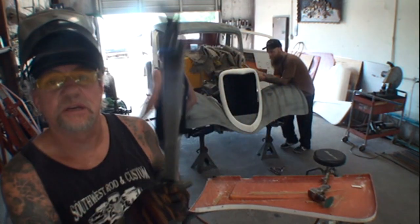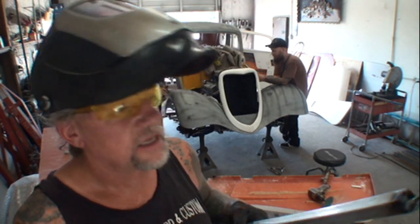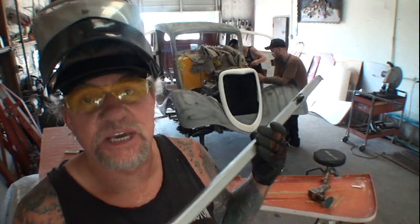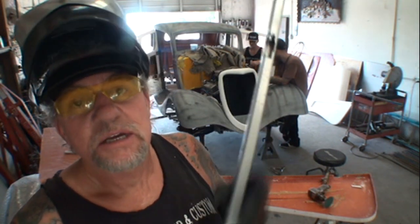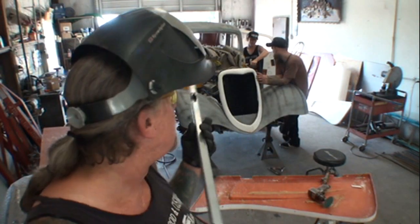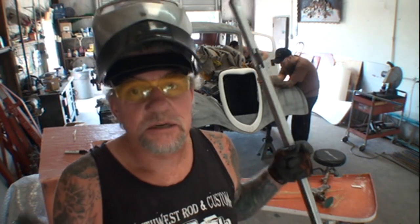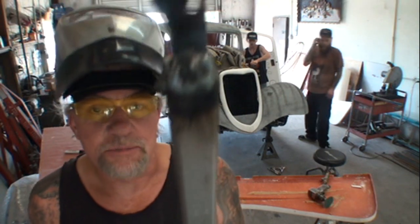I'm going to show you something here. This is a real situation, kind of a little DIY situation we got. When the owner bought this car, all this metal was bare metal. This metal has to be modified. It has to be fabricated and made to work on the car itself. Do not, and I'm going to repeat again, get anything powder coated on these cars until everything is completely modified and secure and ready to mount.